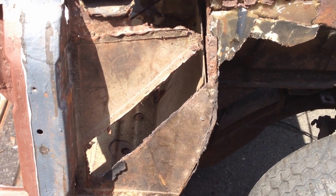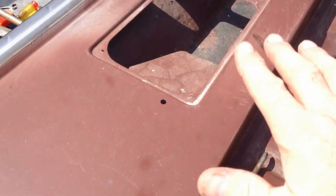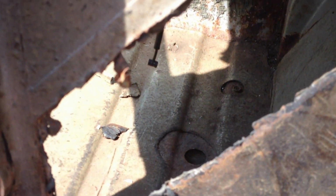But if you look under the fenders, some of the repair work still needs to be done. Because of this cowling up top, you can see the water coming through there for a long period of time, exiting out this drain, which again is under the fender, and it really had no place to go. It went onto the top of this rocker box and got trapped. This is actually a stiffening panel that would have been over this that is missing completely, as there is one here too. So that'll have to be remanufactured and installed. So the foot boxes from the water getting in, though not as bad on this side. I'm sure once we start picking along at it, it's still going to require some work.